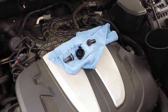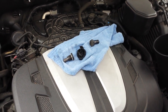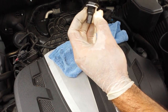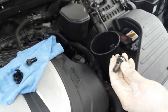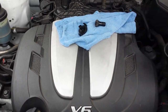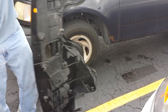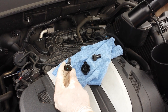A quick video for reference on a Hyundai Santa Fe 2012 transmission fluid replacement. This is a magnetic drain plug located at the bottom of the transmission. You do have to remove the plastic cover — it will save you a lot of time. When you remove your plastic cover, you locate your drain plug.